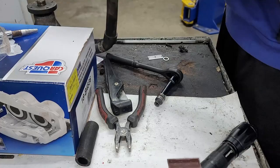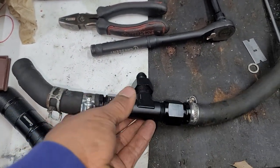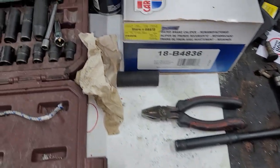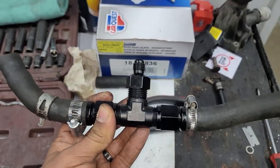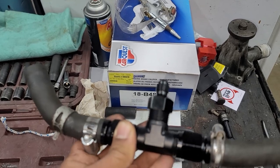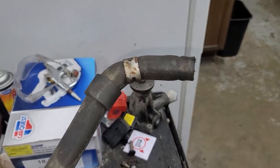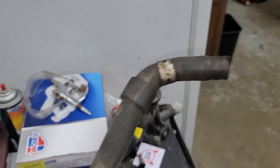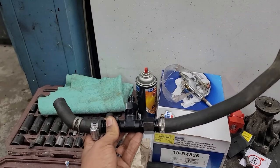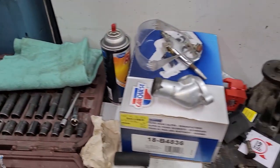As you can see, this is the fabbed-up part. I trimmed a little bit of the hose to try to make up for distance. This side goes to the block, this is the T, and this will run up to the heater inlet on the firewall — that's the first part done, so let's move on to the next.